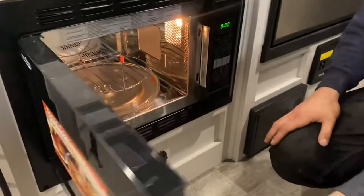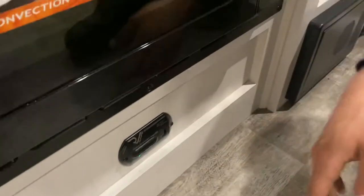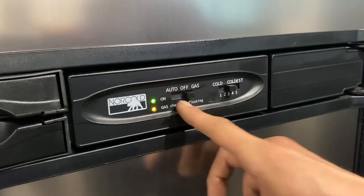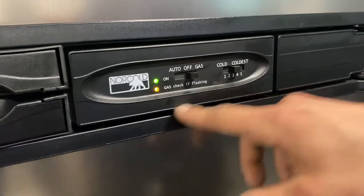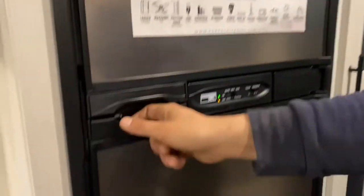Down from there we've got a convection microwave — you can actually cook or grill in it. Below that is an LP detector; propane is heavier than air, it sits on the floor, and this will detect it and go off like a smoke detector. The smoke detector itself is towards the front. Up top is your fridge — the control set to auto will first look for AC power, and if AC power is taken away it'll automatically flip over to gas. If you're boondocking and want it running solely off gas, move the slider over to the right. If that indicator light is flashing, just turn it off and back on to reset it. Freezer up top, fridge down below.